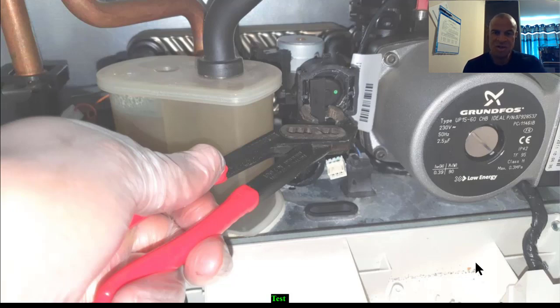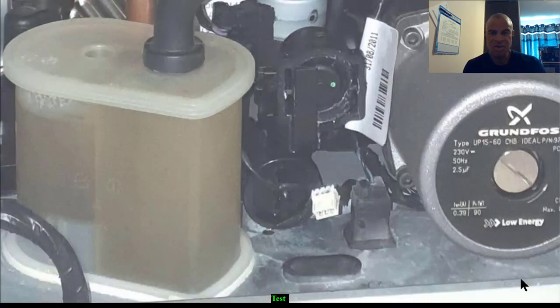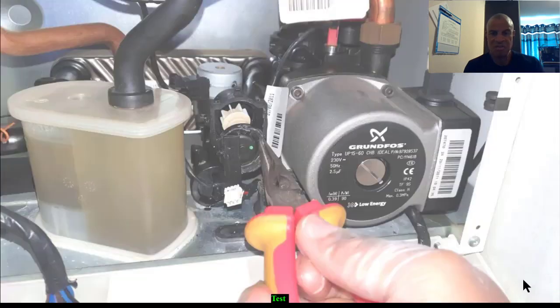Here are some options and tips to get that flow turbine out. One option is to try and lever it towards you to pull it out. To further assist, I suggest using a small terminal screwdriver — get the edges around the body and lever it gently in these parts here and here. Be quite patient; it might take two, three, or even five minutes, because you don't want to break the housing. Once you finally lever it out, you can pull the rest of the flow turbine out from the body and remove it.